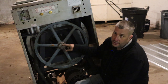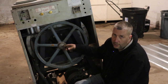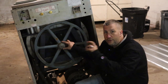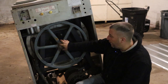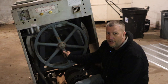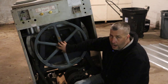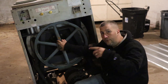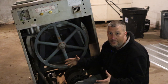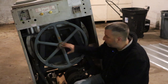Most of these are three-quarter bolts — just take it off. To take off this pulley, it's going to be on there kind of tight. I use a three-jaw puller and I put it on here and just start turning it off. You can tap on this if you want, but it's going to take forever. Don't use a great big sledgehammer because this is cast — you can break cast. I would use a three-jaw puller. Go to Harbor Freight and get that — they have a jaw puller set and it works perfect.